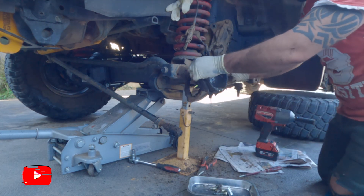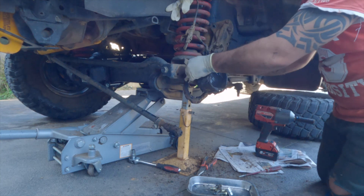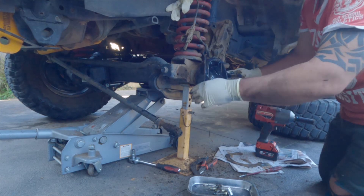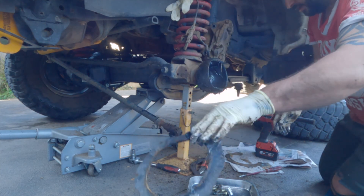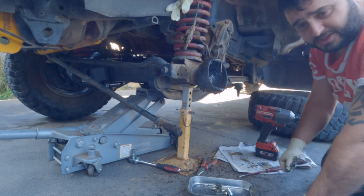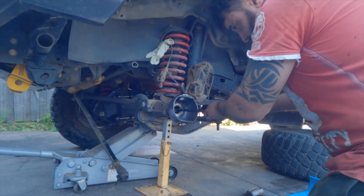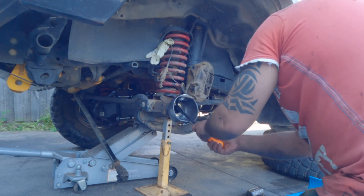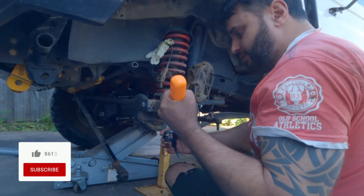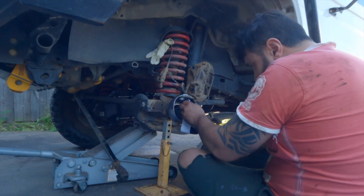Pull the other bearing out. Take off the gasket. They're in the wrong order — normally the steel thing comes out first, then the rubber, and then that. I'll show you which order they're going in in a minute. So the last thing to do is to clean up all the parts. Now we're going to pull out the seal — everything's all cleaned up. Definitely invest in one of these seal pullers; makes life a lot easier than using a screwdriver. There we go — I've only got it a bit battered, but you get that on the big jobs.